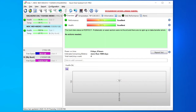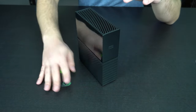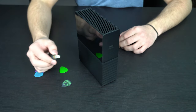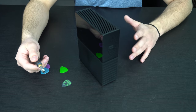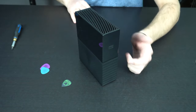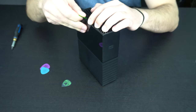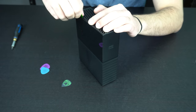You can go an extra step and scan the drive, but I'm going to bypass that for now and start getting the drive opened up. I've got some guitar picks and also a flathead screwdriver, although I hope I don't have to use it. From what I saw, there are three tabs on one side and two on the other, and then you have to pry open the bottom. I've got one pick in and I'm just going to squeeze it over to the side.